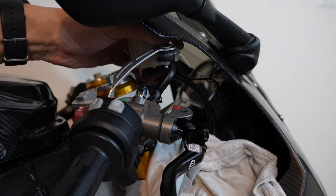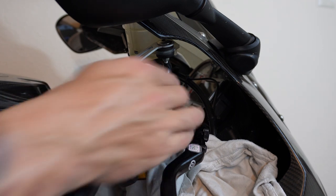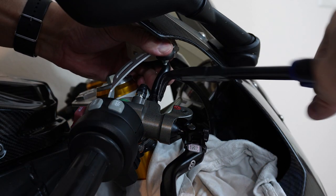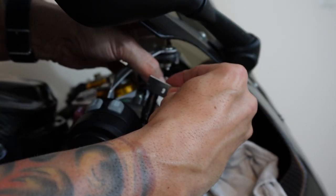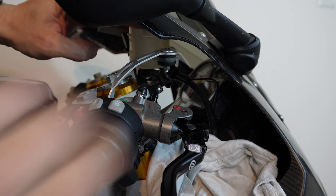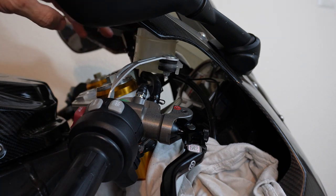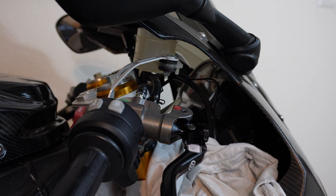That's all snug. Part of it is that I think that tubing is a little bit too long now — you can see that thing has just got too much tubing; it needs to be sitting down closer. Let's take this back off again, put the little clamp north of where we want our cut. Now that we've got a shorter tubing, let's go ahead and slip this on there, get our clamp back down there. Now that looks like it's fitting a lot better.